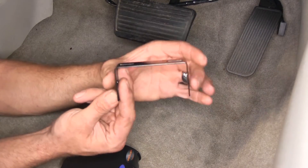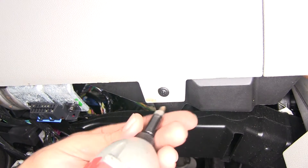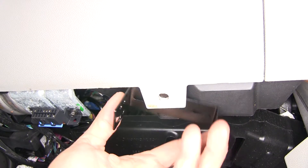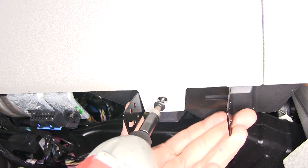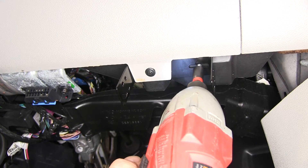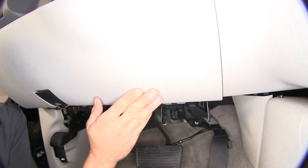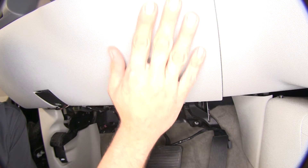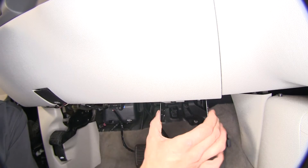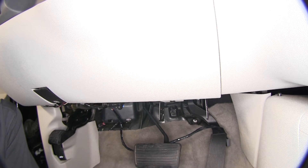For our install today, we're going to use our standard bracket. We've got a great location right underneath the dashboard. There's a screw right here that holds a tab end and goes up to metal behind it — I really like this. We back the screw out, bring our bracket right up behind there, then put the screw right back in, and put a self-tapper over on the other side. I like going under the dash here because we won't have to worry about any holes. You've got the option of going anywhere through this area, though use a little caution going over on the left side up high — you might bump it with your knee. With this being a proportional system, as long as we stay within our degree-of-angle tolerances, we can mount it wherever we want, as long as it's within reach and can be safely operated.